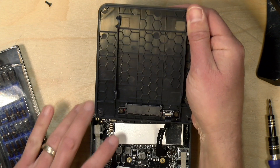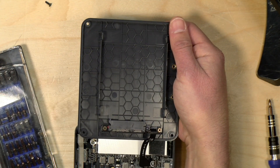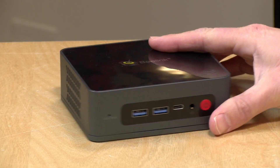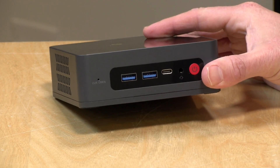There is room for a two and a half inch SATA drive as well, so you can have one drive installed in that M.2 slot and another one installed on the back of the case — a more traditional laptop two and a half inch SATA drive. You can also upgrade the Wi-Fi, which lives underneath the M.2 SATA. It comes with AC Wi-Fi on board, but you could go to Wi-Fi 6 by swapping that card out. It does have an Intel card installed. This one runs the maximum RAM configuration of 16 gigabytes and supports DDR4 RAM at a maximum speed of 2,933 megahertz.